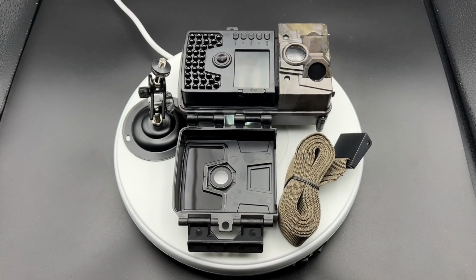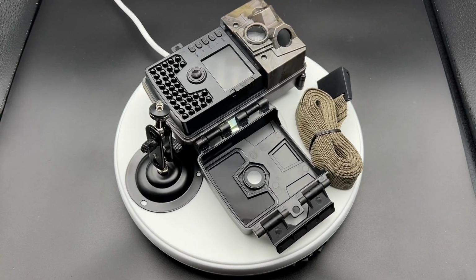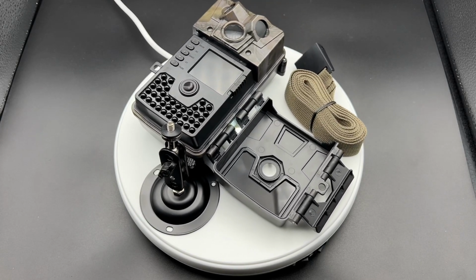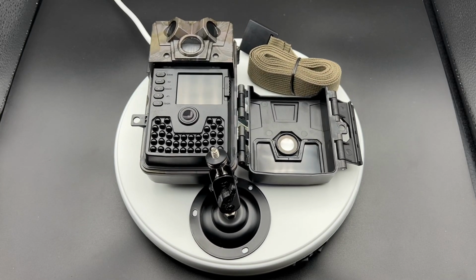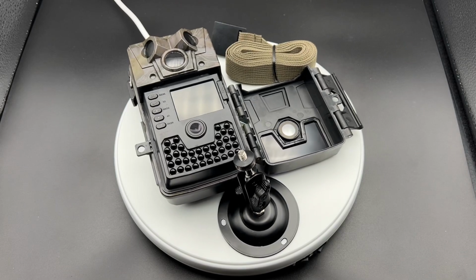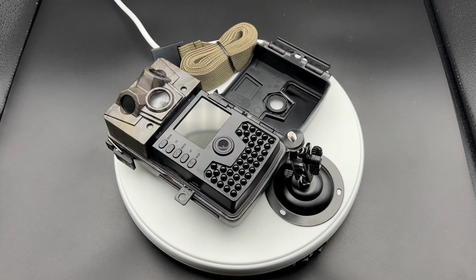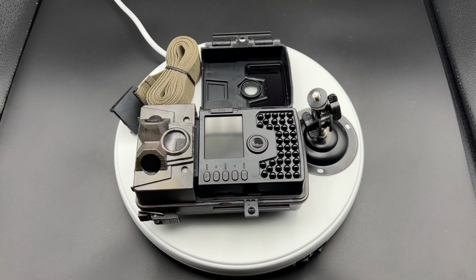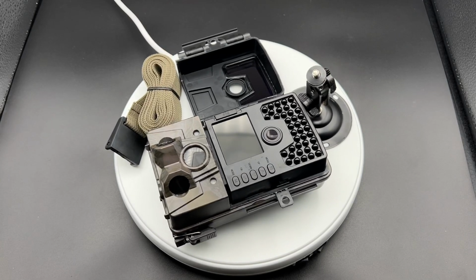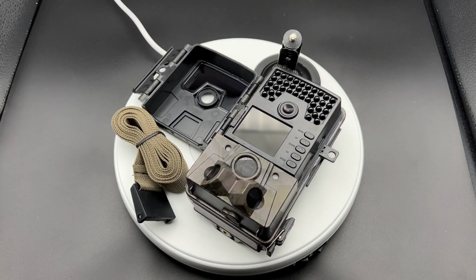Once we switch to the on mode, the left light indicator's blue LED will blink for about 5 seconds. This gives us time to close and lock the front cover of the camera and then walk away. During this time, the left light indicator LED will blink red continuously. After it stops blinking, the PIR will be activated. Any motion that is detected by the PIR sensor will trigger the camera to capture photos or videos as programmed in the setting menu before.